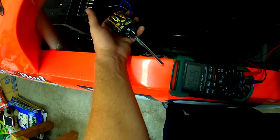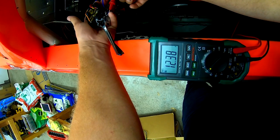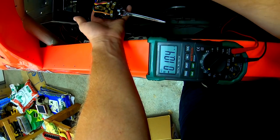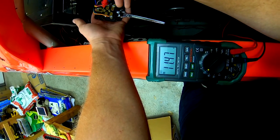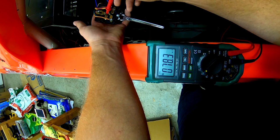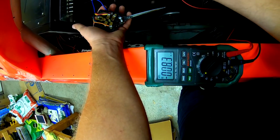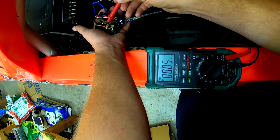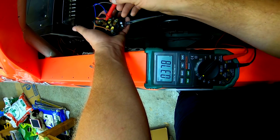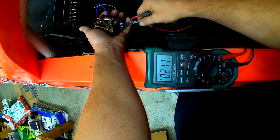All right, so on this switch, at the blue wire, which is coming out of the flasher, I've got 12 volts. When the switch is idle right in the middle, here at the negative coming off the flasher, I have 11.5 volts. These are all dead, don't have anything. Now if I flip it to one side and measure, then on two of the sides I've got 2 volts. 2 volts and 2 volts, and then this also becomes 2 volts. And same thing with the other side.